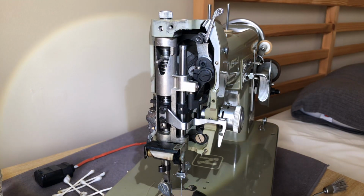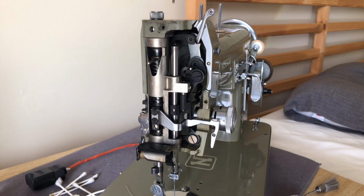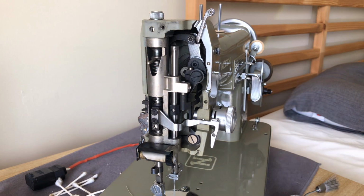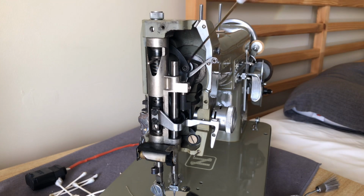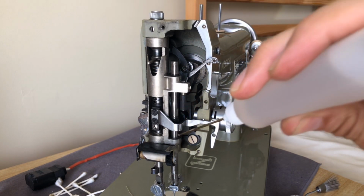So what I'll do here is I'll come behind. There are no gears in here, so I'll come behind with sewing machine oil. Again, we're going to use the same technique I've used in other places. Normally, you'll go up top and push the little spring-loaded cap off of there, and start putting oil in. Normally, you put 1 drop. That's normal maintenance. But this machine is dry as a bone. It could be 30 years since it last saw any sewing machine oil. So instead of 1 drop, you're seeing me put probably between 2 and 3 drops in some sections.